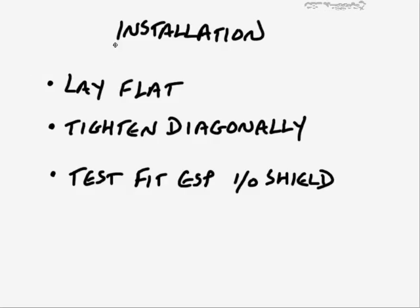And then when it comes to the actual installation, there are a few tips that I can provide for you here as well. Number one, do lay the case down flat so that you can use gravity to work with you as you screw in the motherboard into the screw holes. And the reason for this is because if for some reason you were trying to do it where the case was upright, for example in a tower configuration, then the motherboard could constantly slip while you're trying to install it. It just makes some common sense to lay it flat.